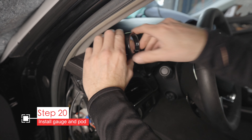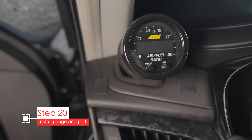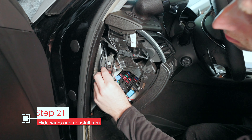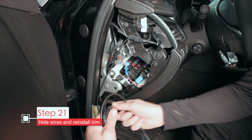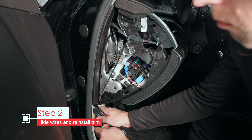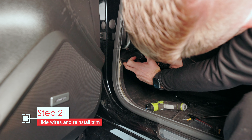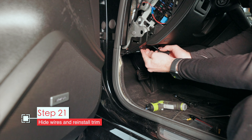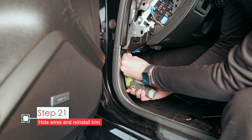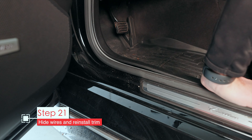Press the pod in carefully, make a small final adjustment, and that's how it should look. Now it's time to put all the wires away and put everything back. Loop up all the wires and stuff them underneath the carpet on the left-hand side, tied up neatly — they'll fit fine under there. I removed the screw under the left side of the dash so I could lower it and reroute some wires so none are showing. Once the OBD2 plug is plugged in, put the screw back in and replace the fuse panel cover. Finally, put the threshold trim back in place.